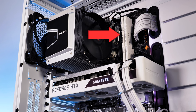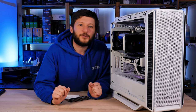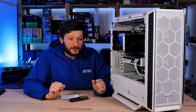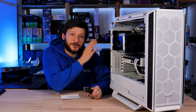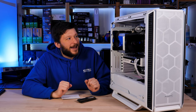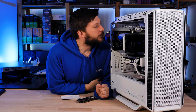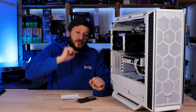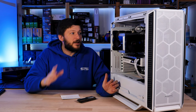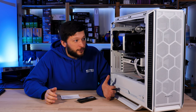The story behind that: yes, I know it is wrong — I did it on purpose. The reason is that RAM slot A2 is dead. I was not able to get any stick of RAM running in it, not even a single one. I tried my Trident Z's, the G.Skill Aegis, every combination — nothing worked. Also, I think slot A1 is also dead because trying dual channel mode in the other two slots still doesn't work. I even did a BIOS update. A1 and A2 are probably both dead, so I had to do it this way.